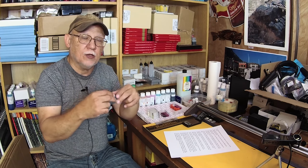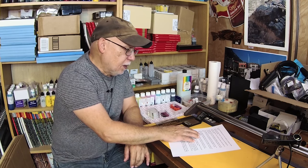Now, Precision Colors — I'm the one that reported there was a reaction between the two yellows. It tends to gel up and causes a clog on your yellow channel, which is undesirable. You don't want that to happen on a thermal printhead — you'll ruin it. So if you're going to order from Octo Inkjet dot co dot uk, get the cartridges and get some ink. Then you can top off your own carts after you modify them, and have two sets ready to go.